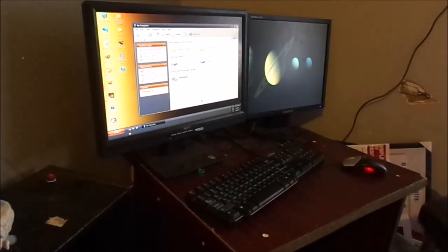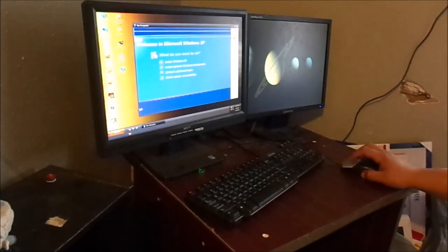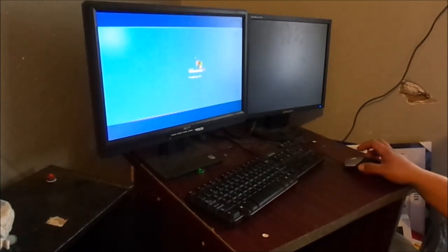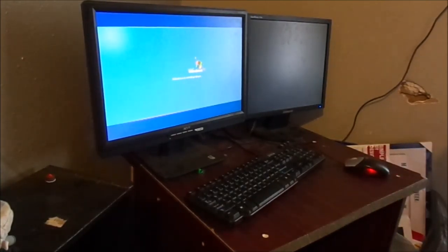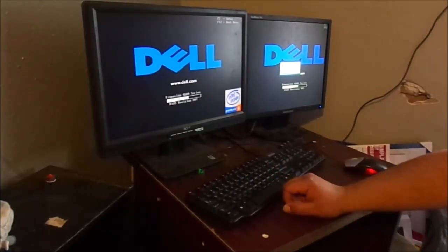Okay, so the computer is now started up. And the CD drive is in there, DVD drive. Let's go ahead and open it. Make sure it's reading. Okay, so it is reading. So jumpers are set correctly. Let's go ahead and give another try now. And I can already see the computer working faster, so maybe that top CD drive was the one causing conflict.